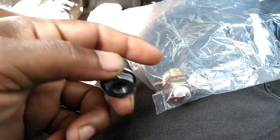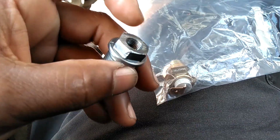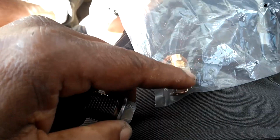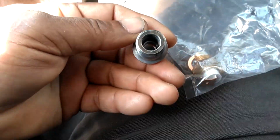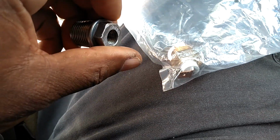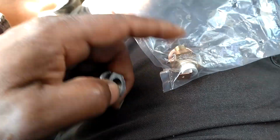Man, that thing ain't even close. The tip of the sensor might go in there, but the head of that bolt is threaded much different. So I may go get another bolt from somewhere and figure out the thread pitch on that, drill out the bolt so that that hole is straight through, and then thread the deal in the head of it. May be enough for the head of the bolt in there to use. So we'll see how I figure out that. Man, I got so much to do, I don't even know where to start.